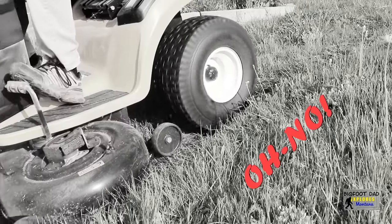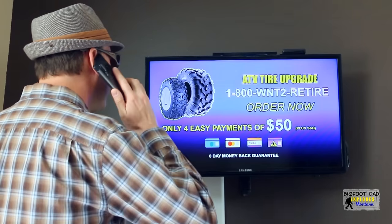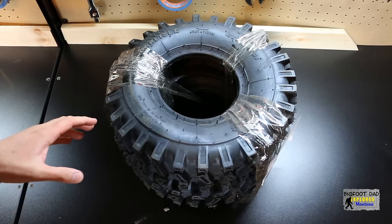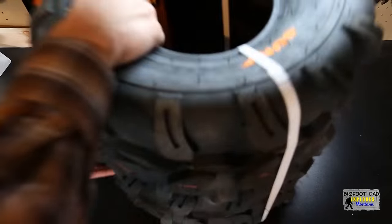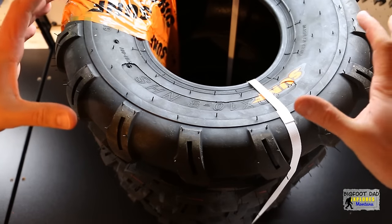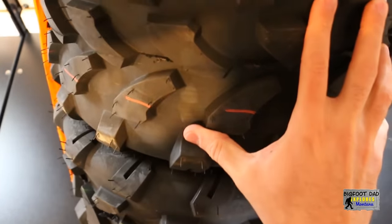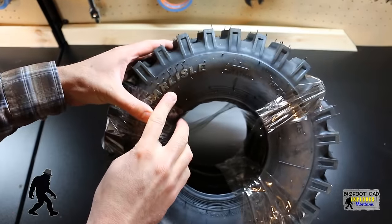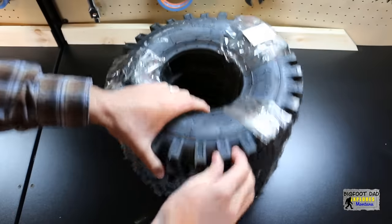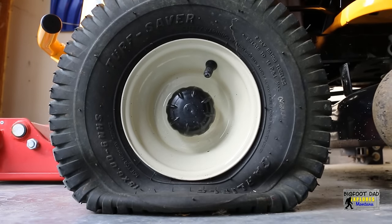Having trouble mowing your lawn but your tires just won't grip? Well then what you need is an ATV tire upgrade. I'm going to install a set of aggressive tires on my mower. Sure, it'll help it grip better and make it more resistant to tire punctures, but just look at these — this is the essence of dibs. For the rear, I bought a 20x10x8, which, although a bit wider than the stock tire, should fit the rim nicely. For the front, I found these Carlisle X-Tracks — 15x5x6s, which means they'll be a little more narrow but should fit on the stock rims without an issue. This tread is quite aggressive and should give the extra grip needed when maneuvering on steeper terrain. Let's get these wheels off so we can begin our tire swap. We'll jack the front up first and lay the axles on jack stands.